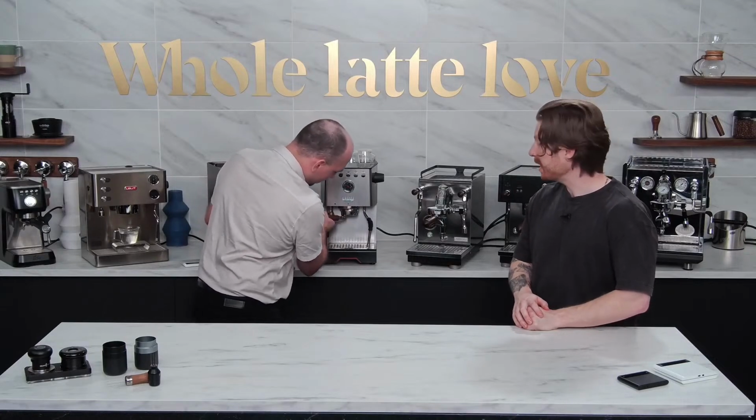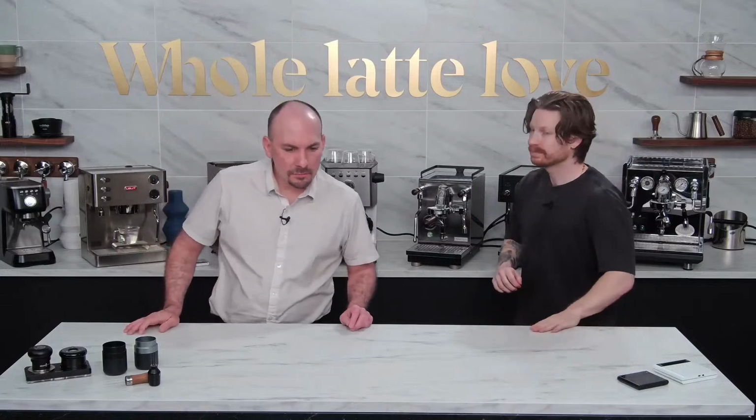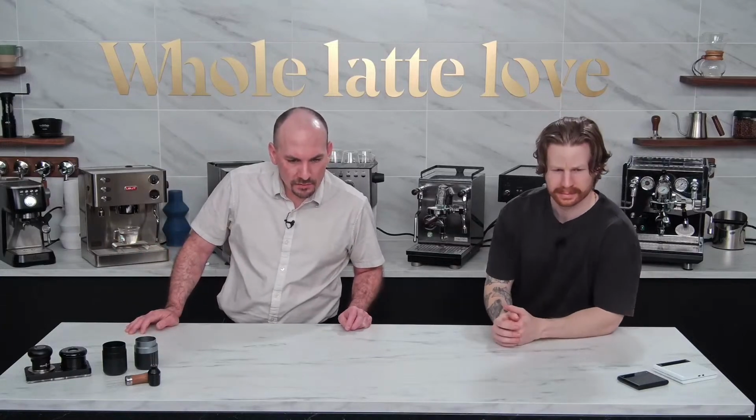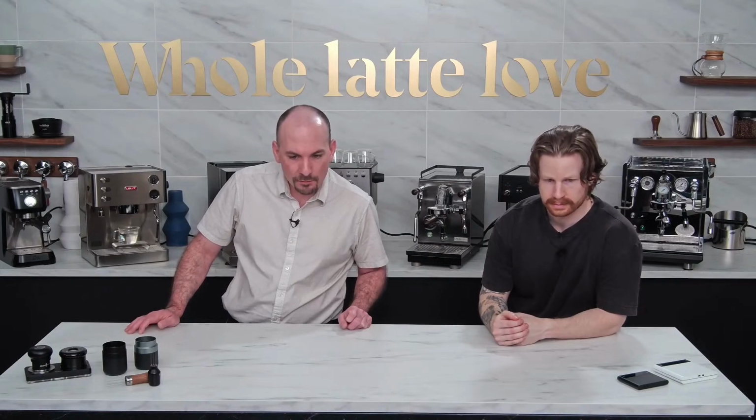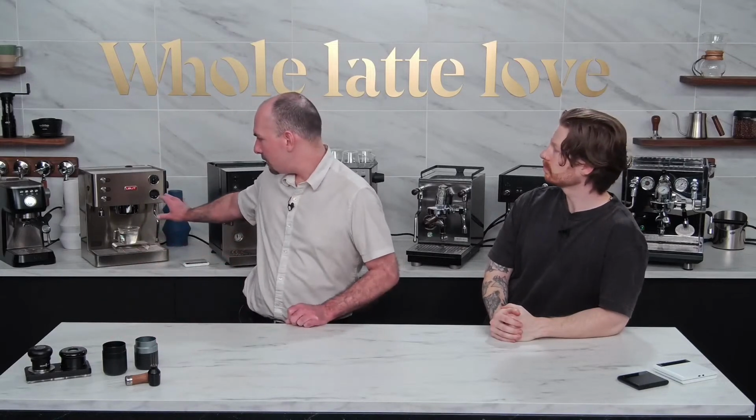So there's basically any way that you want to fully saturate that puck. Yeah. Got from Stefan, quick observation, the Elizabeth uses steam pressure around 3 bars for pre-infusion when the steam boiler is turned on, or pump for pre-infusion when the steam boiler is off. Yes, although Stefan, the one thing that I would note too though is that basically the pump did only run for a brief period of time, at which point with the solenoid valve still open, just the latent pressure inside the boiler is allowing the rest of that to drip out.